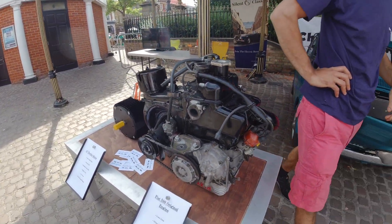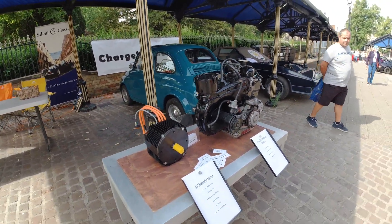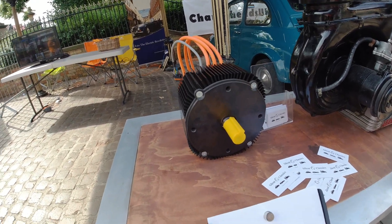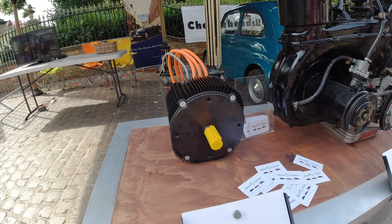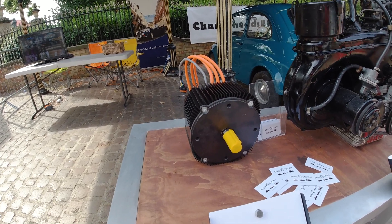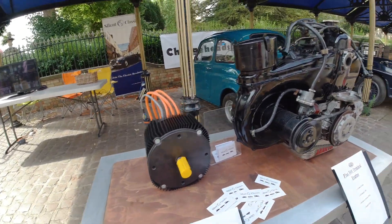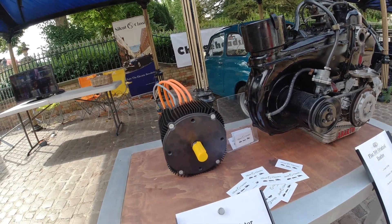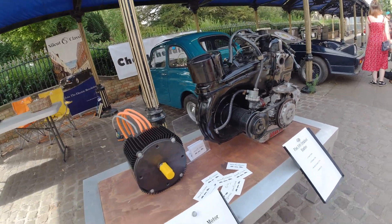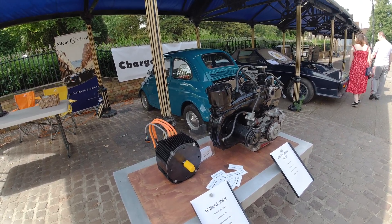I love the fact that you've brought this to the stand. This is the motor — that's a 64 brake horsepower, or 48 kW motor, at 92% efficiency. Efficiency is so important with electric motors. Compare that to 19% efficiency on the original engine. And the weight: just over 21 kilograms for the electric motor versus 68 kilograms. Obviously efficiency is best for the environment as well.